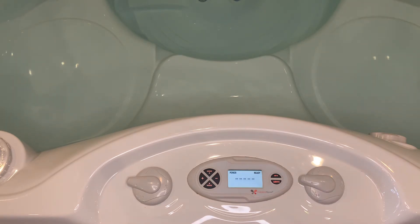What this means is your hot tub heater has overheated and the high limit sensor has tripped, shutting the heater off so that it doesn't burn anything up.